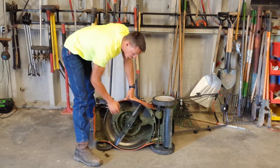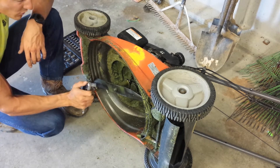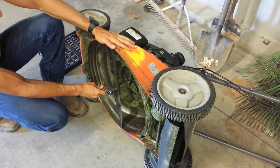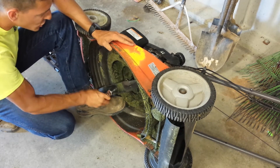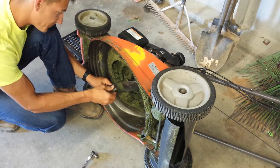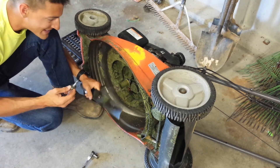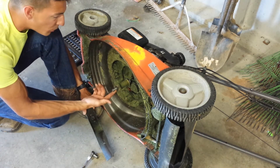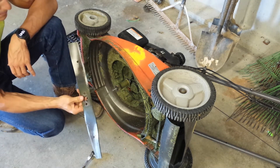So once you've got access to your blade, we're going to grab the tools and pull this blade off. To remove it is really very simple — you grab the right size socket, put it on your socket wrench, make sure it's in reverse, and then try to twist it. What will happen is the blade will rotate, so all you've got to do is take your boot or a piece of wood, put it in there to block the blade, and then loosen that bolt up. Once it's nice and loose, reach in with your fingers and unscrew it the rest of the way. Pull the bolt out, then pull the blade off. Now take the bolt, put it back in the hole, and thread it on just a little bit — this will prevent your bolt from getting lost and your washers from going everywhere. Now let's head over to the workbench and sharpen this blade up.